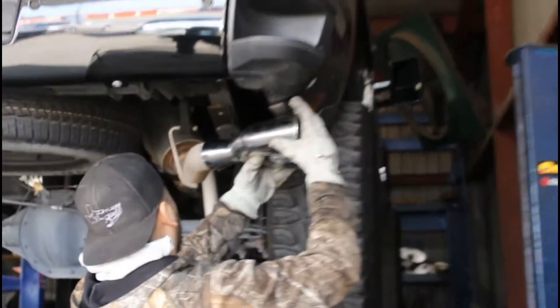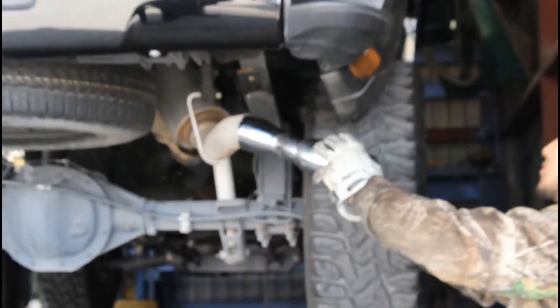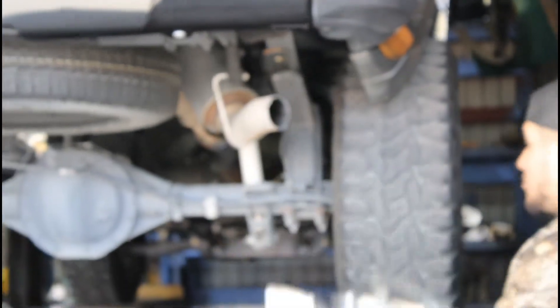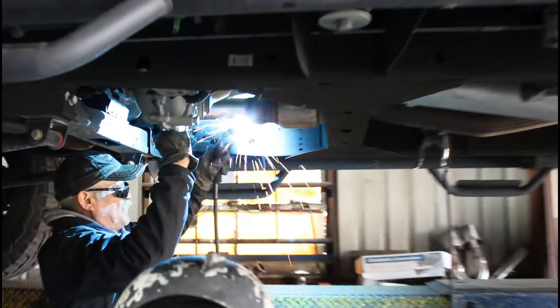The mechanic told us that for that truck, they're quiet pretty much no matter what you do. You really have to torque the exhaust and put all kinds of different things on there to get what you want — it's just that generation of truck. He said he can cut both mufflers off, the big muffler and the small one, then straight pipe it and put one small carbon muffler on there.